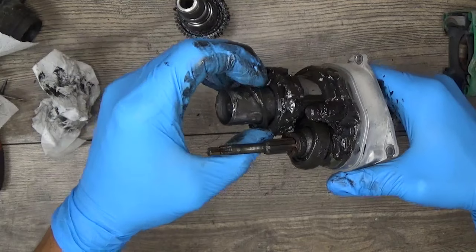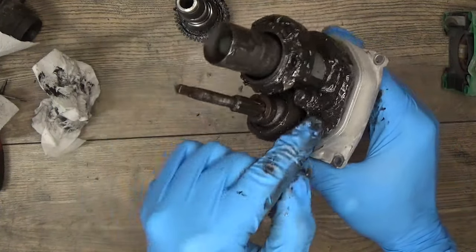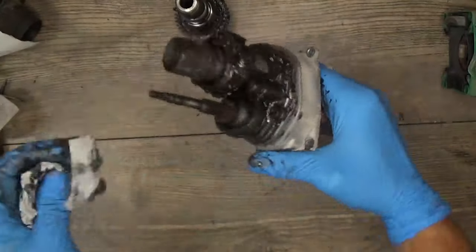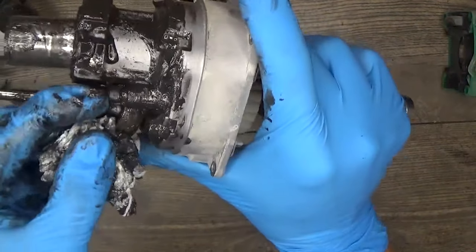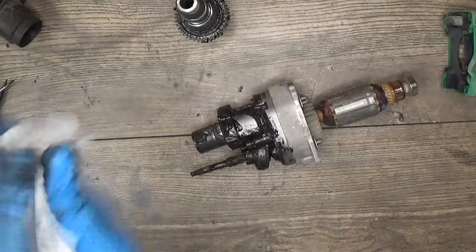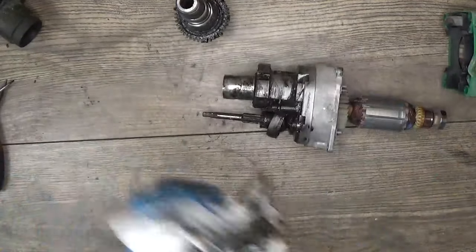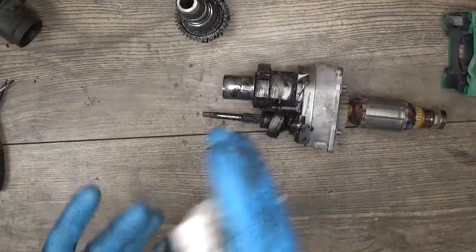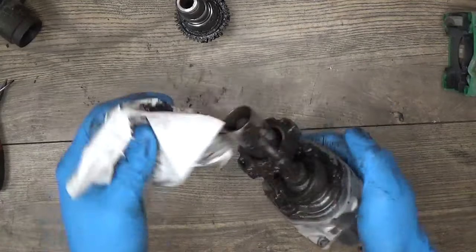We have the washer. Now it is our cylinder and the swash bearing with two screws holding it. I will unscrew them. Now just cleaning — it will be nicer to touch it. Of course you can remove the armature and dip all the parts into a parts washer if you have one, then disassemble. But you leave it to dry again after disassembly.